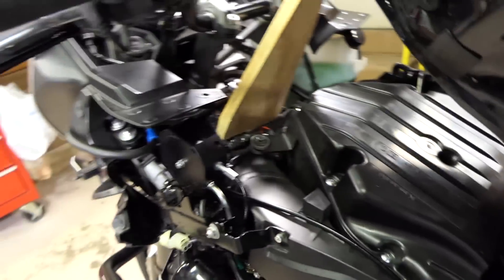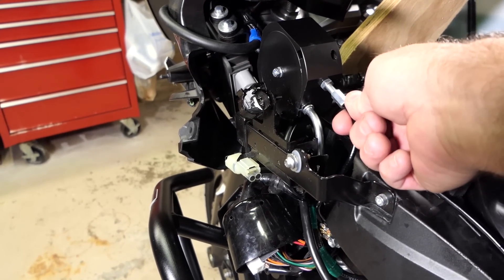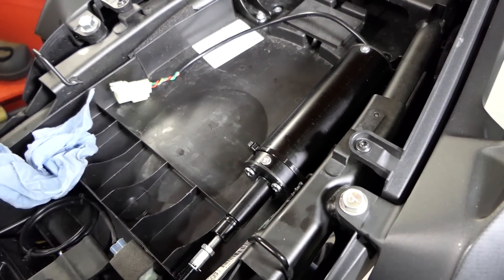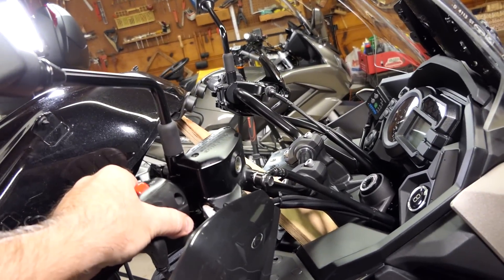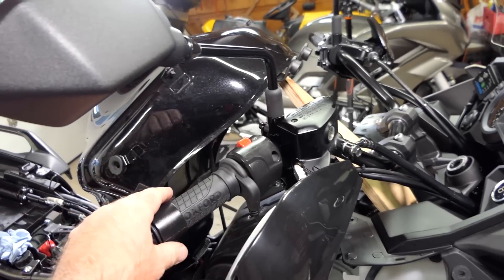The cable interface unit is mounted up there in the little pocket under the dash. The instructions ran me through a rough cable adjustment — I adjusted this end according to what they said, and for the servo cable I ran it out about 10 threads for now, leaving final adjustment for later. I put the throttle housing back together and did an adjustment on the throttle cable — the one we loosened all the way — to get the free play they wanted in the grip.